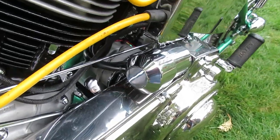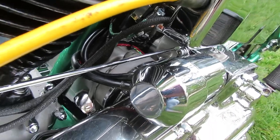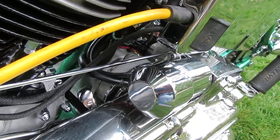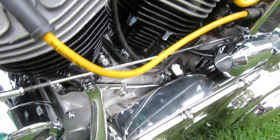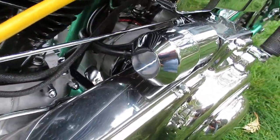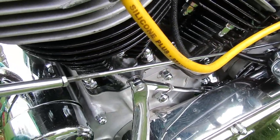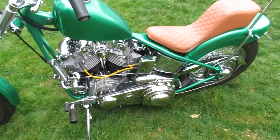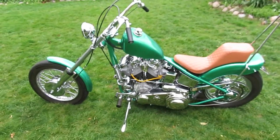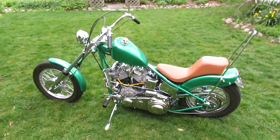Here's how the mousetrap works. 1967 was the last year for this — they went to the mousetrap eliminator, solid clutch cable, in 1968. I had to find the clutch actuating arm, the special one for electric start with mousetrap, found that on eBay and chromed it. When I was talking to my buddy Dave about the steering rod — a long skinny rod about as big around as a pencil with a knob on one end and a little flat spot — he started laughing and said he had it in his bench drawer in his garage. So he sent that to me, so I've got its original parts back together.